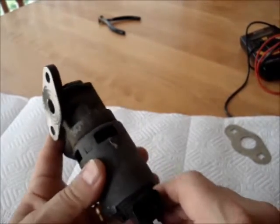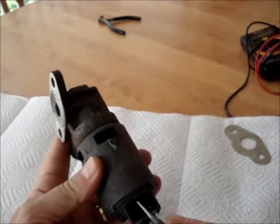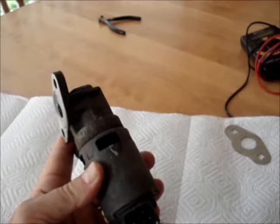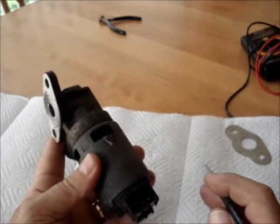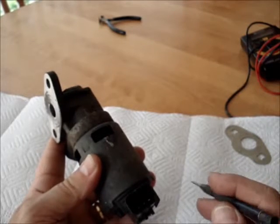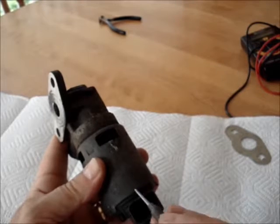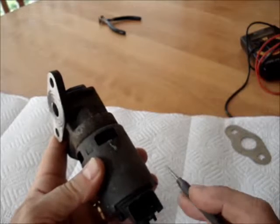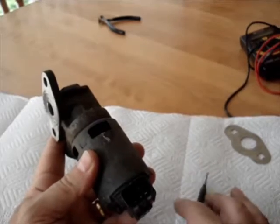What I ended up checking out is, I checked continuity and resistance between pin 4 and 5 down here, and I got about 7 ohms resistance. Between pins 4 and 5, that means the solenoid was good, but if I put 12 volts on there, it still didn't move.